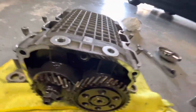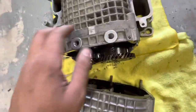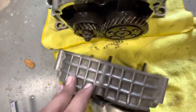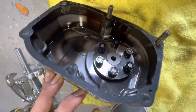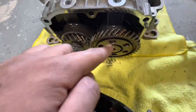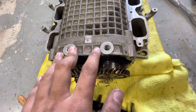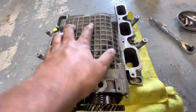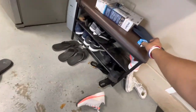So there are two front parts of the supercharger: the snout and then a second section. Don't forget — some of the pins might stay in the holes, so make sure you grab them. I'm going to separate that second section and once I do, the rotors should slide out so I can access the bearings.